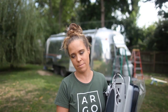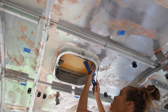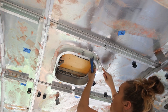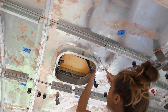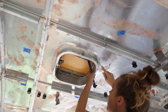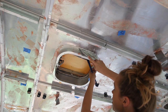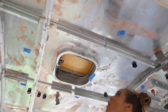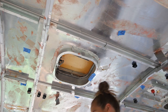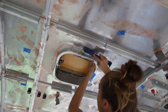Let's get started on the worst part of this, which is taking out the old skylight. Take a couple different scrapers and see which one is working better. It doesn't really matter what tool you use — whatever method helps you scrape this off. Oh my gosh, this is going tremendously faster than the last time. You just need to scrape it enough so that you can see the rivets that you need to drill through. It's not super important to overdo it. I'm going to try this bigger scraper — maybe it's because it's warm outside, but this stuff is coming right off.